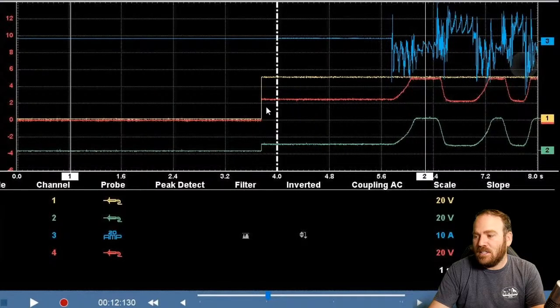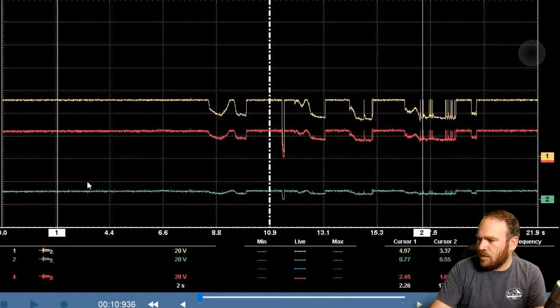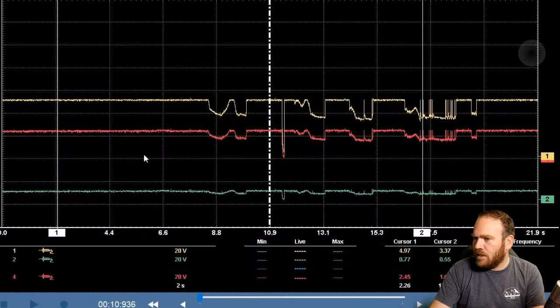Gears, we were talking about how that one was sitting at 2.4 volts and the other one is at 1 volt. We can see that as soon as the key gets turned on, they start out at a stepped rate or an offset on one of the throttle position sensors. And then this one here, I think, is that current? I'm just trying to look at the channel labels. They look kind of messed up and weird. No, he's probably just sweeping the throttle body back and forth, but both channels are following each other. We don't see any strange dropouts or glitches on one that's not reflected in the other.